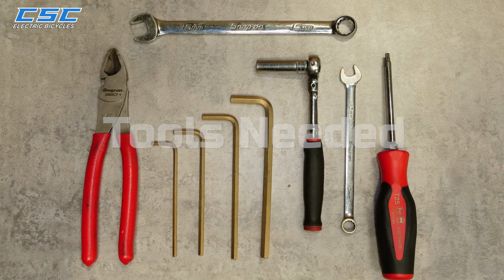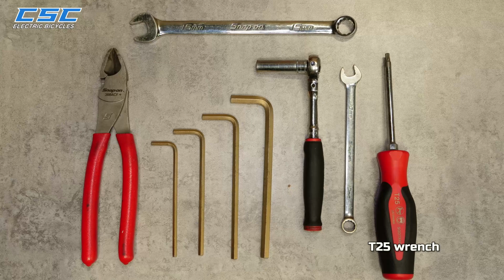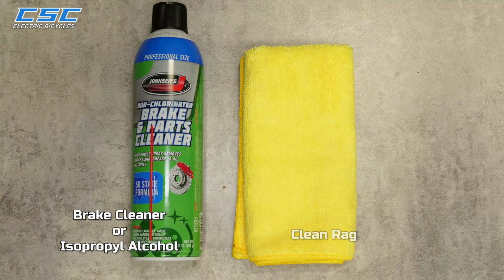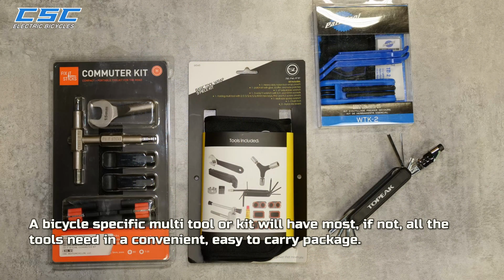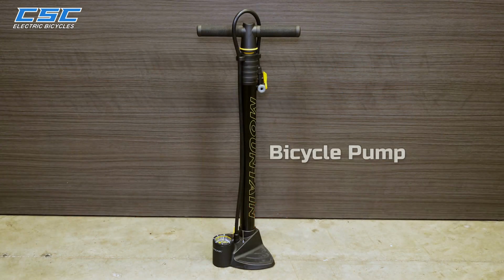Tools needed: 4, 5, 6, and 8mm Allen wrench, a Torx T25 wrench, a 15mm wrench, 10mm wrench and socket, side cutters, clean rag, brake cleaner, or isopropyl alcohol. A bicycle-specific multi-tool or kit will have most, if not all, of the tools in a convenient, easy-to-carry package. This is highly recommended. Check the links in the description. A bicycle pump.